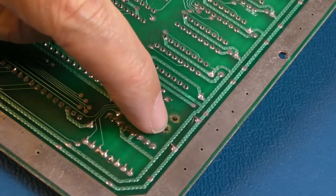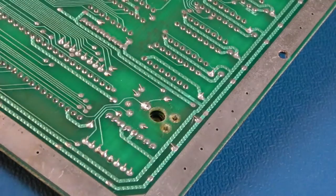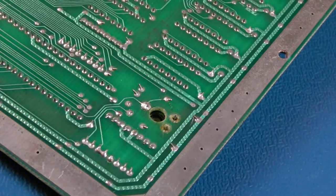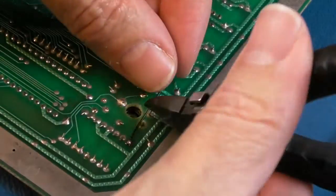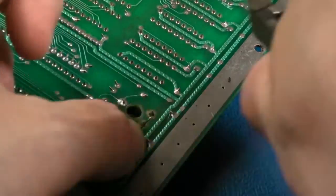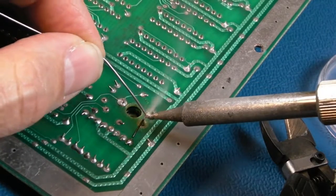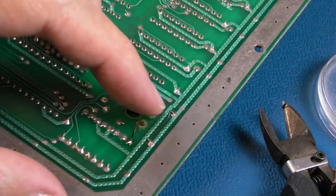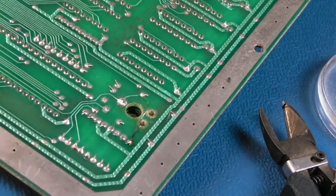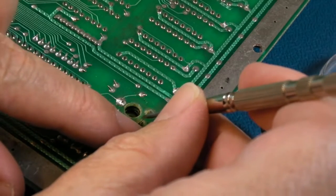You know, this leg here goes underneath the component on the top side to that point there. So we just need a little wire there. So the wire would be a bit temperamental. It's going to melt back just a little bit and then it should be just the right distance maybe. Yeah, there we go. And I'm going to put it flat like that. It's a bit longer now than we need it. So what I'm going to do is just wrap it around the pin.